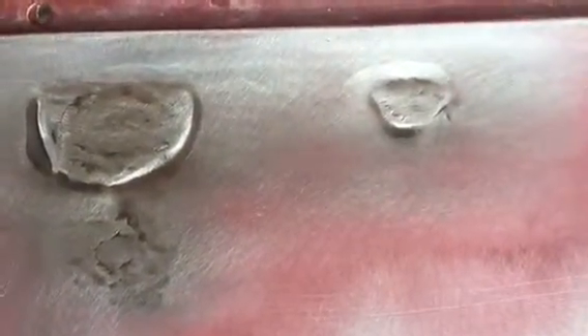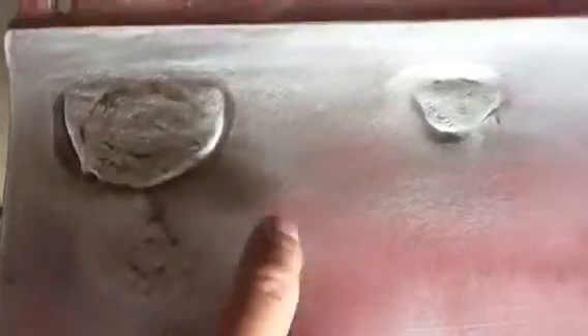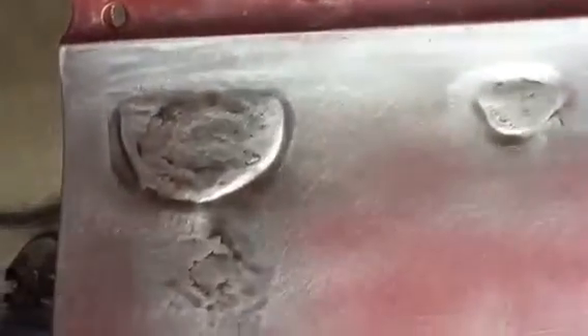Here's the close-to-finished product of the shaved door handles. You've got a little low spot here, there's an edge around it and a little bit right there. Really it's up to you — you could go ahead and use body filler now, or you could use lead to fill that in and then do some more metal body work. But this is good once it's welded in. Once you put a DTM on it and do body work, it'll last forever and it's not gonna crack.